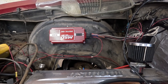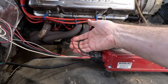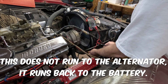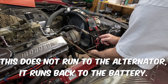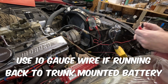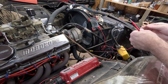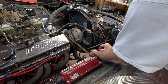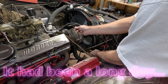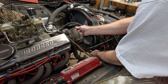So let's go on to checking voltage. We want to check the voltage of these two wires. My positive is right here and I have it grounded right here. I've got to turn the key on — key was on, I just forgot to turn the kill switch on. So there we go: positive, negative, ground. We got 12.3 volts, so we're good.